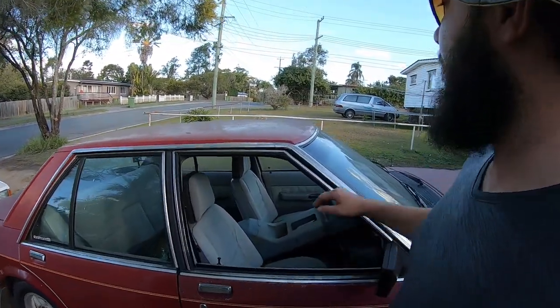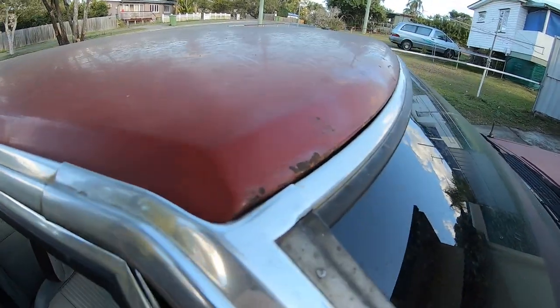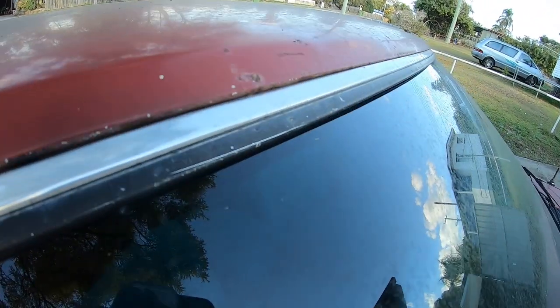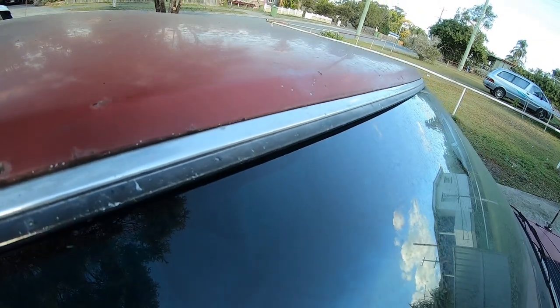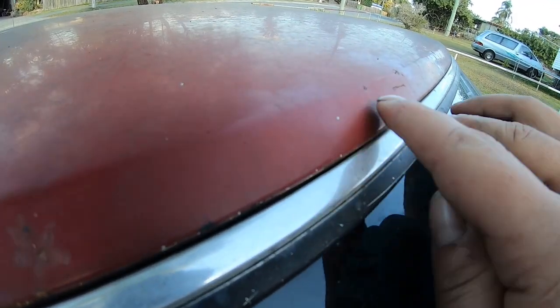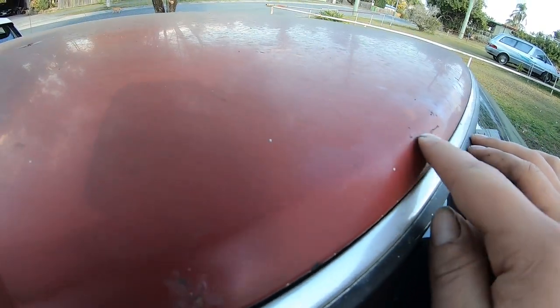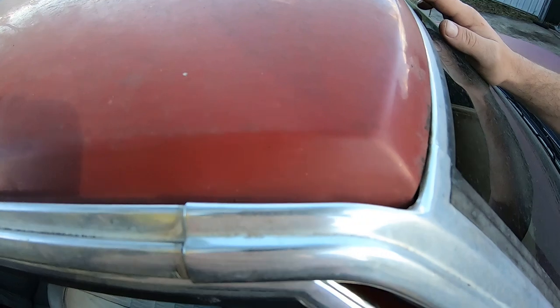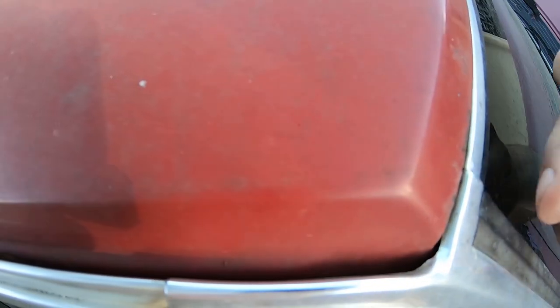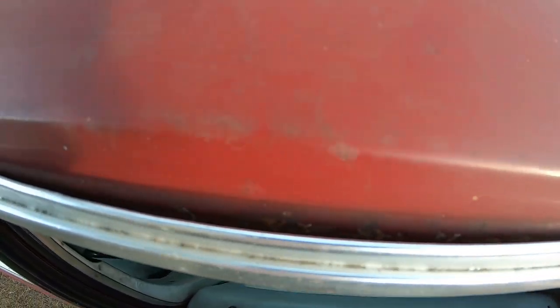When I look at old cars, the roof is at eye level, so you want to be checking it out. You're not really too concerned about dents — obviously they're going to be costly to repair — but you're mostly looking for rust. Things like surface rust from a cheap paint job or a stone chip. What you really want to be wary of is anything that looks like it could be rusting from the inside back out, where it's breached. Look down into these channels and check the drip rails.